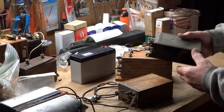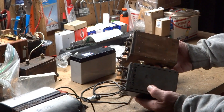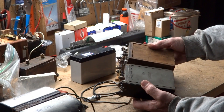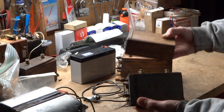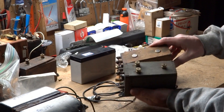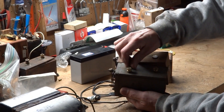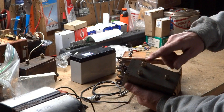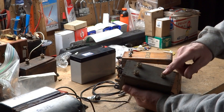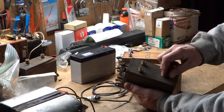We also have another older version — it's basically a Model T coil. As you can see, it's the same coil size and same coil design, just a little bit different. Instead of having the button contacts, we have three thumb screws, and they're identified: T is for the timer, P is for the plug, B is for the battery, and S is for the spark.